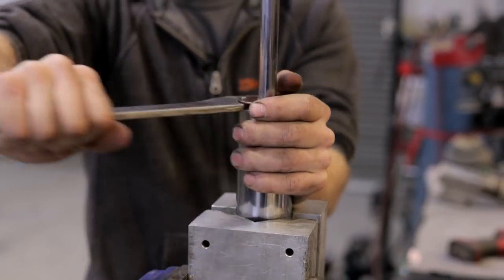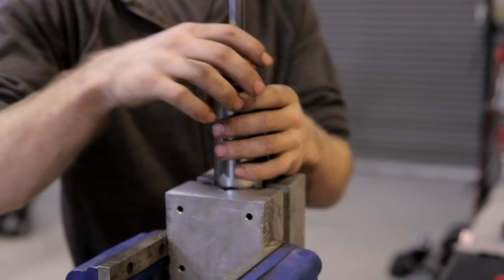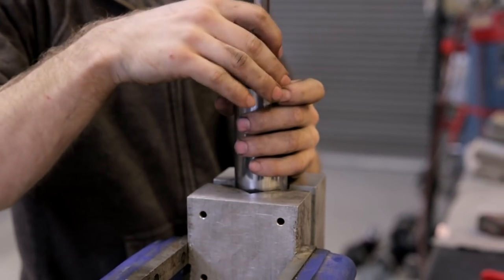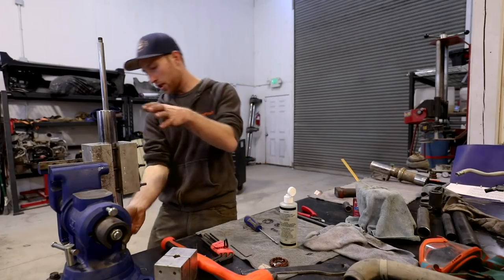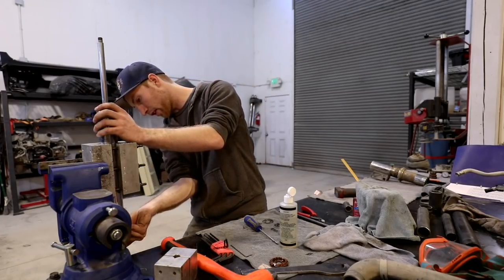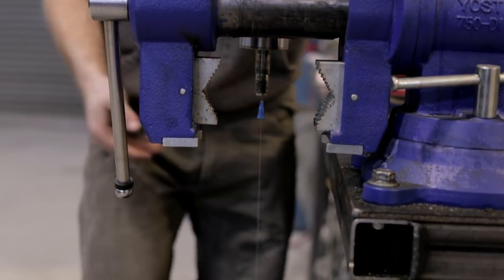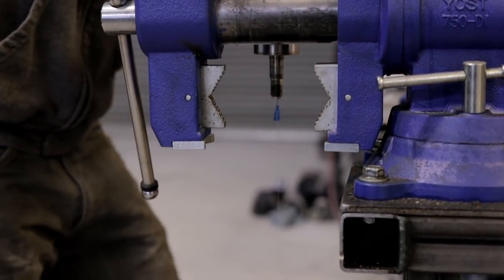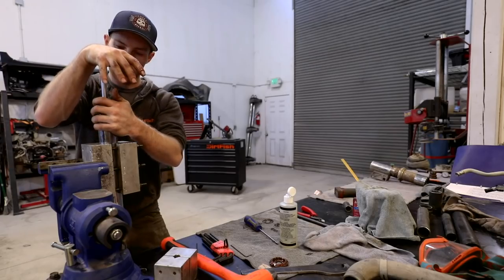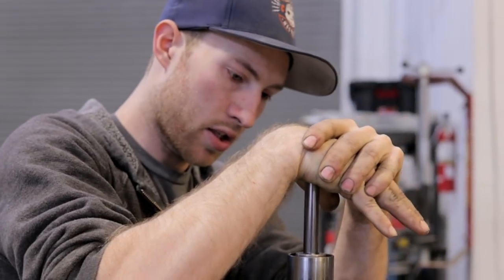So here we're taking the shock top off. So down here, I'm going to put a needle into where you fill the air. This will deflate the shock. A little bit of fluid will come out with the Reiger setup. My goal here is to get the shock into a negative pressure.